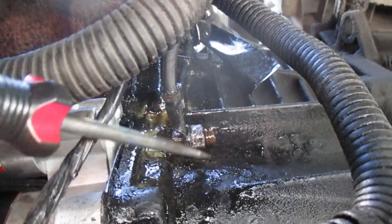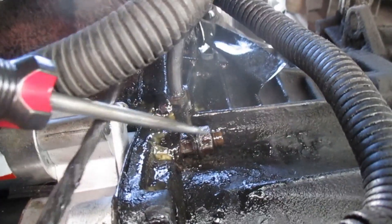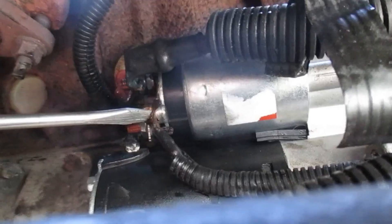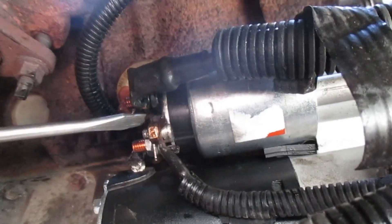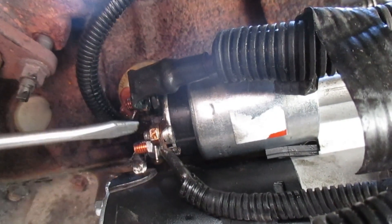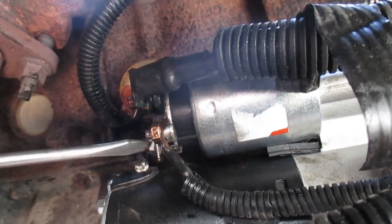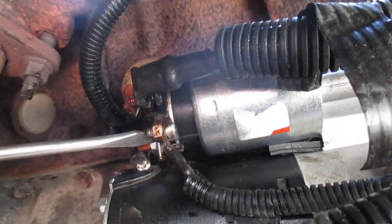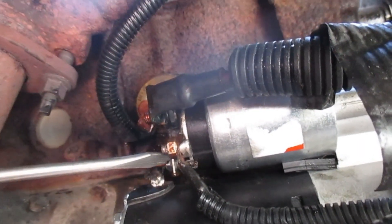I've made our electrical connections. Here's the cable with the two nuts on the other side I was talking about. Over here we've got our ground wire connected and power up there. By the way, when you're tightening these up, be careful that this cable does not come down and get too close to the nut that has the ground wire underneath it — keep those separated.